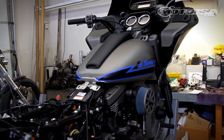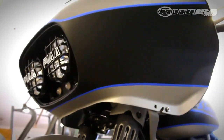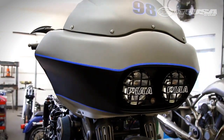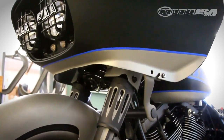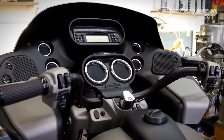On this phase of the bike, we took the whole headlight system out. The Harley Road Glide has a headlight system built in with a bezel around it. We took this all out, built a panel, put off-road lights in it. We got some turn signals in there, and built a panel on the back to kind of suck everything and draw it in — a neat feel that I haven't seen anybody really do on a bike like this.